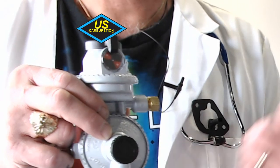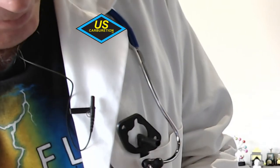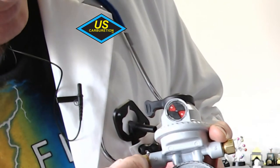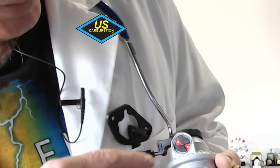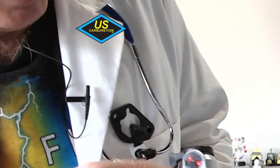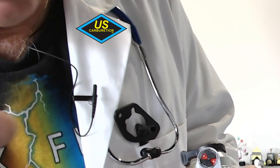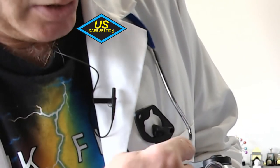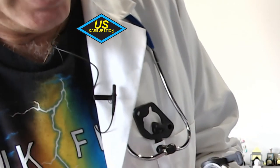All right. This is a changeover regulator. So you see the flag. What you do is you move this to the side that you're pulling from. So you look at it, you go, okay, I'm pulling from this cylinder over here. Now, the flag's red, so this says both of them are empty. But when this flag is red, this regulator is now pulling off this side, even though it's pointing this way. So you know, oh, this side is empty, it's red. When you flip it over here, the colors change. Now you can disconnect this cylinder